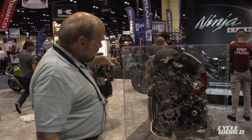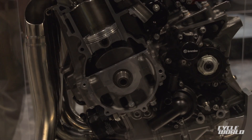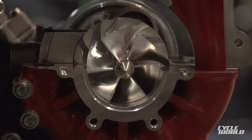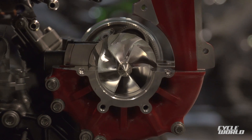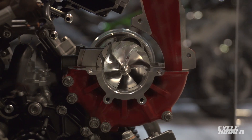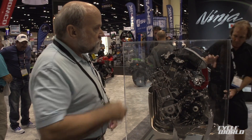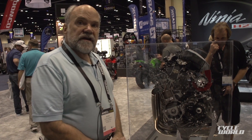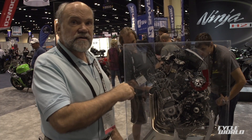But on this machine, instead of the air coming into the air box from the front, it enters this supercharger. You see that complicated, organic-looking whirly gig there. It has six inducer vanes and as it rotates at speeds of up to 140,000 RPM, it accelerates the air outward to a velocity of close to 1,500 feet per second. And when you give air that much energy and bring it to a stop, the energy of velocity transforms into the energy of pressure.